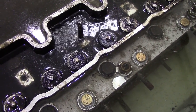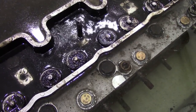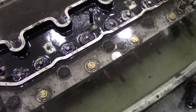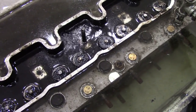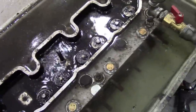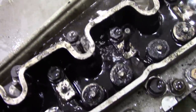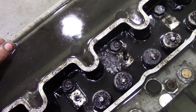I'm wondering — could pressure be forcing water out? I don't think there was water in the oil, but I'm not entirely sure. There are no cracks from anywhere else, and there's a big thick rubber gasket at the bottom on a 5/16th plate so that can't be leaking. It's leaking from the head. I put my finger inside and it's on the tube where the push rod goes through.